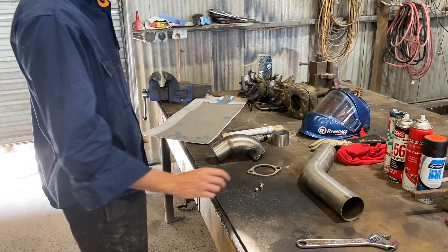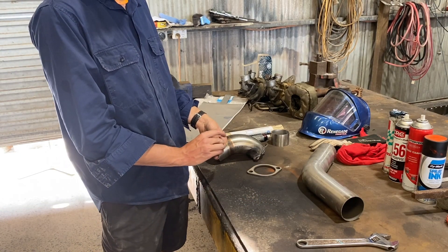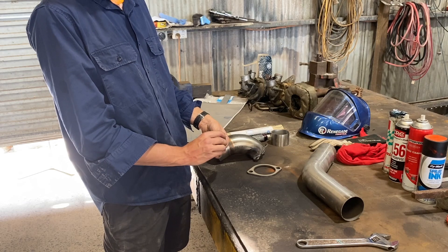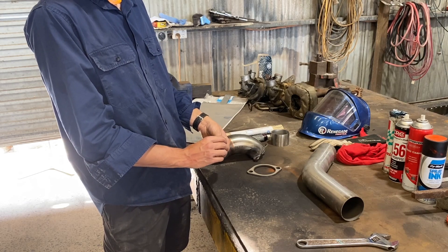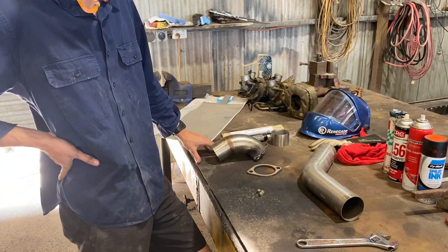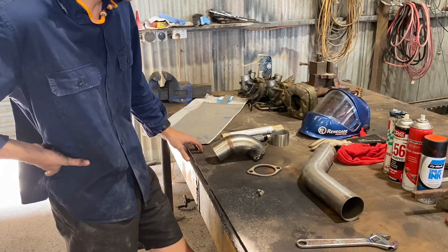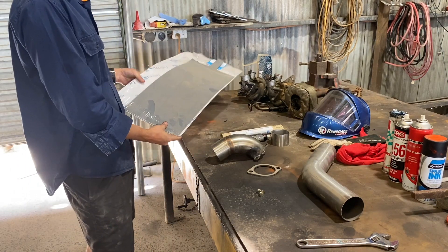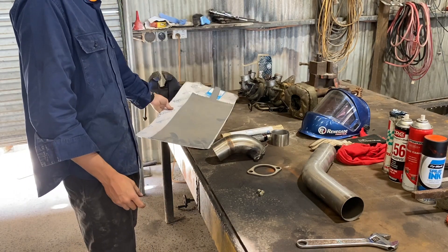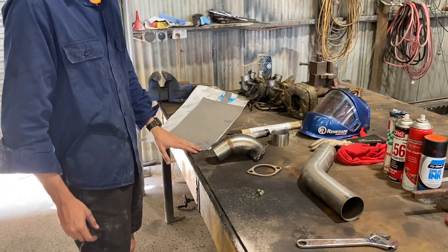Got the studs in, these are the nuts left over — you've got to pull them back off. Important thing to remember is if you've got the turbo off at any point you should really re-tap the threads; it'll just make it a lot easier to get the new studs in. I did that yesterday while I had no studs in the turbo. The other thing is I found some gasket paper, some exhaust paper, which will work a lot better than any of this sealing stuff — that was just a last resort.